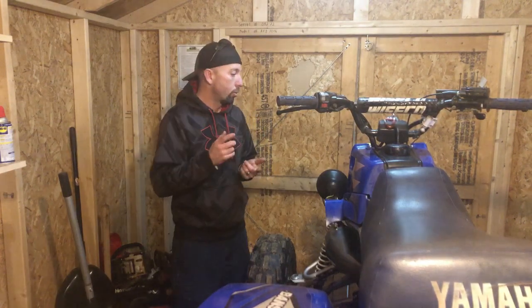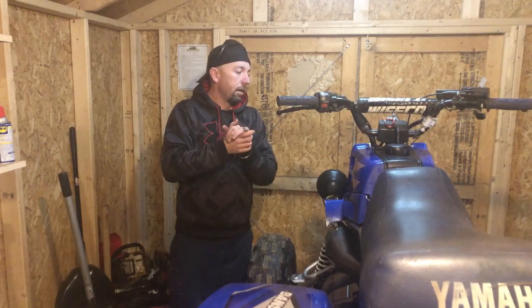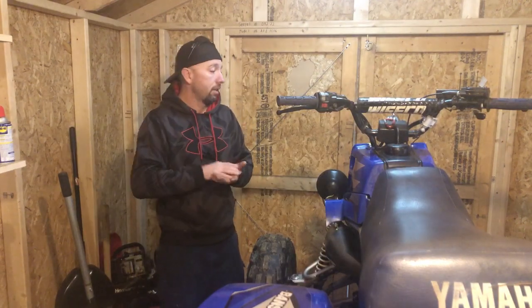And also while I was in on the clutch side, my hub's worn out. I'll show you guys that. That's over here. It's grooved really bad. The pressure plate's good. That's not really grooved. That passed my inspection anyway. And then we got the inner hub too. That was grooved really bad. That should be in at some point today.